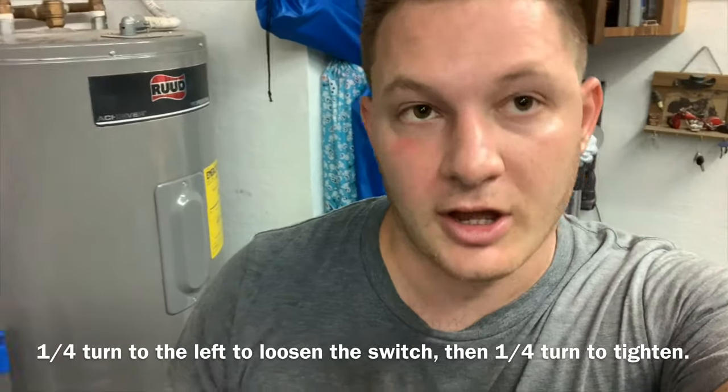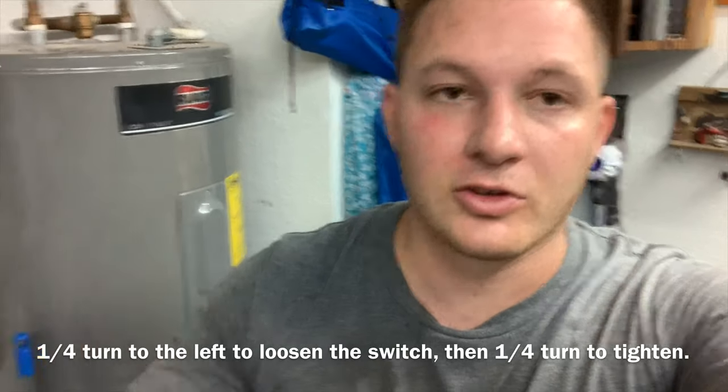Well, hopefully this video helped you guys install the clutch master cylinder. It's definitely not bolt on. You have to jimmy some shit. You have to make a whole new bracket, the one that holds the clutch to the ball. You have to adjust your brake switch. Oh my God, you have to cut the fucking welds. It's so much shit. It's just not fun. Nope. So anyway,